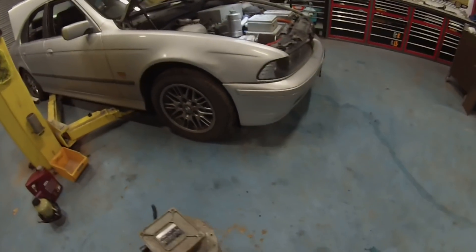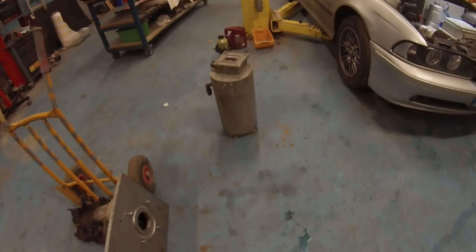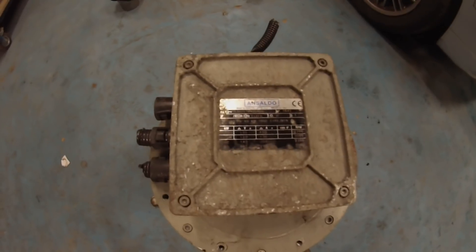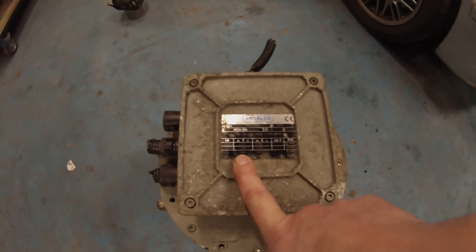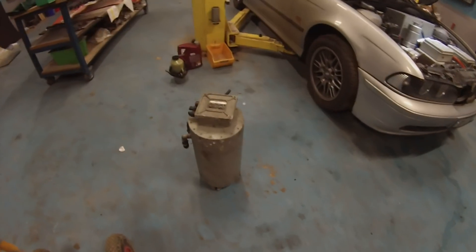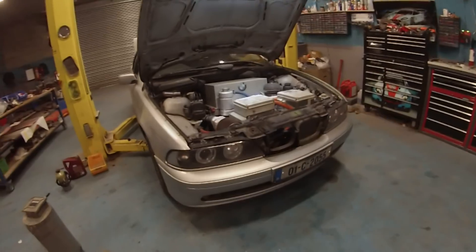This particular motor came out of a horribly converted Peugeot van, and it has one rather good thing going for it: it has been wound for 140 volts. That's going to suit us pretty well for our 192 volts, since that will be our max AC voltage. Ideally it's probably wanting about 220 to 230 volts on the DC side, but we'll get away with a little bit of field weakening and the gearbox.